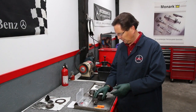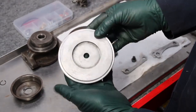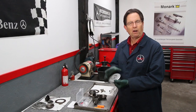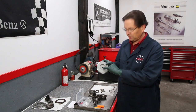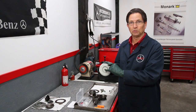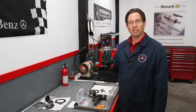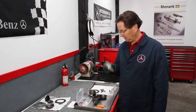The other thing is excessive wear in this front plate where the front sealing ring seats — it's part of the compressor housing, the back plate of the compressor housing. If this is excessively worn, you're going to have problems with performance in the turbo too. Unfortunately these parts are very difficult to get sometimes, but you want to pay particular attention to that.